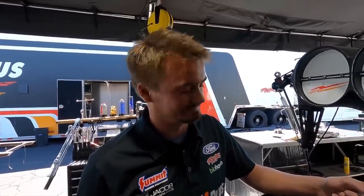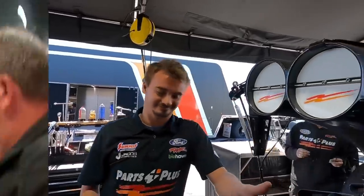Yes. So you're actually cranking the motor backwards, so in case there is fuel, you're putting it into the headers. Yep. And that is a safety thing. Yes, every team does it, and if you don't, it's been seen before on this channel what will happen. Thanks, Peter. Boom. All right, Bruce, it's your turn here.